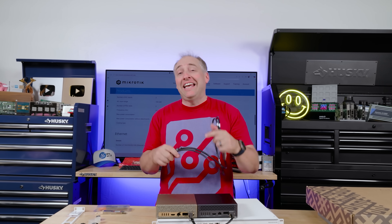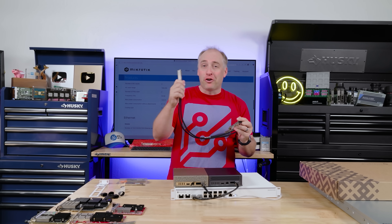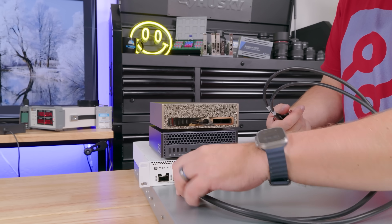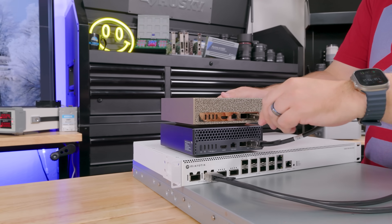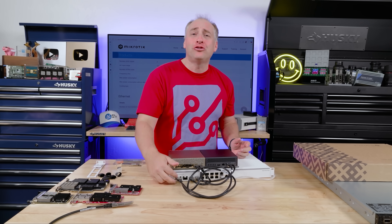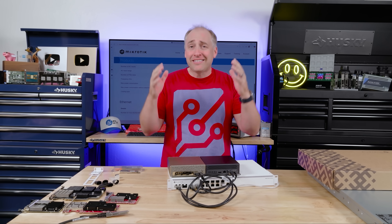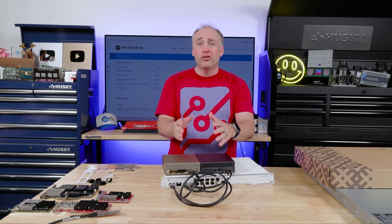When I was doing the pre-brief call with NVIDIA for the DGX Spark, I literally showed this switch and said you could use this to scale out to a bunch of them. Not only can you do the simple two-unit DAC configuration, but you can also use the 400 gig QSFP DD ports: since they have two 200 gig lanes, you can plug a 400 gig DAC on one side and use the 200 gig connections on the other — connecting two units per 400 gig port. That's two on one 400 gig port, two on the other, and one more on each QSFP56 port — six right there — plus the SFP56 ports at 50 Gbps for storage, other servers, or other networking.